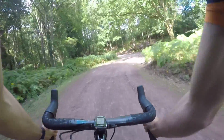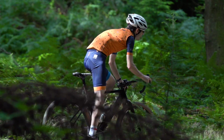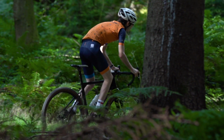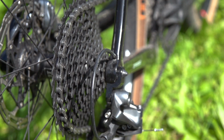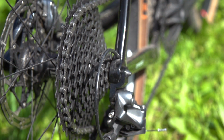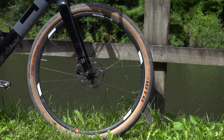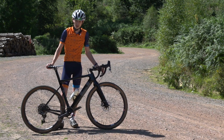This bike's got a 38 tooth narrow wide chainring on the front and a 10-42 cassette, and for general riding that's kind of all you need, I've found. Obviously the steps between gears are not tiny, but for kind of tooling around it's fine. I probably don't need to justify the choice of having disc brakes on a bike like this. It would frankly be mad not to. They work great, end of story.